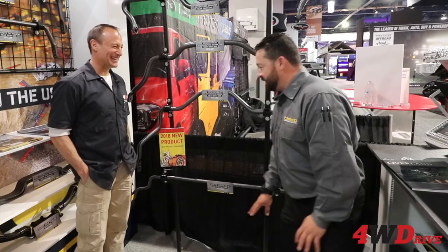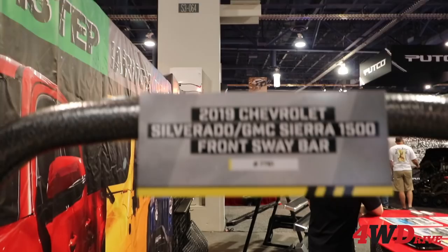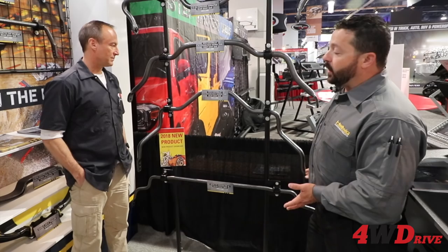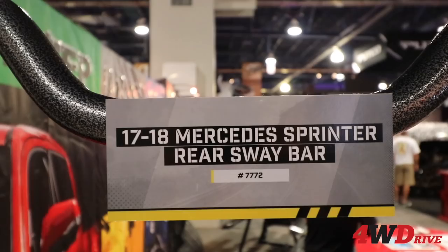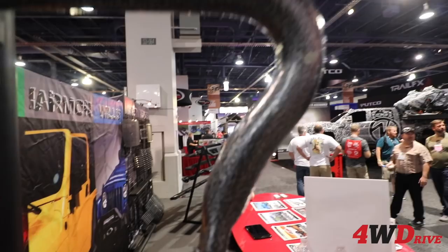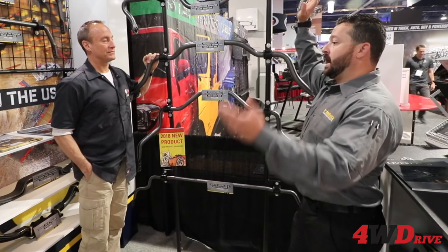GM released a brand new platform for their 1500 series trucks — both the Silverado and the Sierra — so we've got a front and rear sway bar for those. These are solid bars, 4140 chromoly steel, and the rear bar is adjustable for tunability on understeer and oversteer. Up top is the 2017-2018 Mercedes Sprinter rear sway bar. In the overland community, the Sprinter is a big and growing platform — people go off-road and outfit them for long camping trips. The rear sway bar takes it from a high-center-of-gravity, floppy driving vehicle and turns it into basically a box race car.